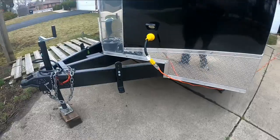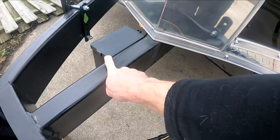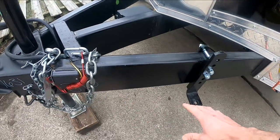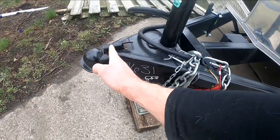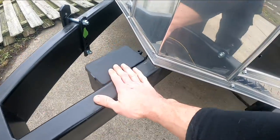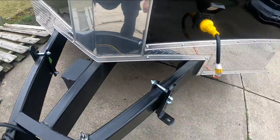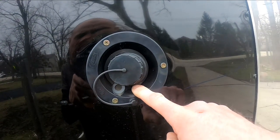I had to move the battery tray — there's a little 12-volt battery that runs the interior lights and some other bits. It was located here, but the sway bars for the hitch — the bracketry has to be a very specific distance from the center of the ball hitch — ended up being exactly where the battery was. So I had to relocate it and wire it back in with longer wire to make that path.